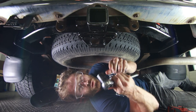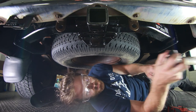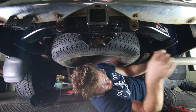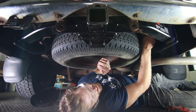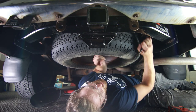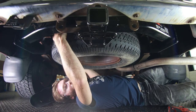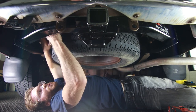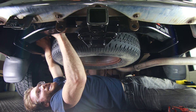I was trying to use a short half-inch socket on this back bolt but it's not deep enough to fit over the bolt, and the deep socket I have is too deep. So I'm just going to use a regular wrench and snug that down. This is where dropping the spare tire would actually be helpful. It wouldn't be a bad idea to put some Loctite on these bolts, and if you're not doing that you'll probably want to check them after a month or so of driving, because bolts can loosen up during that first month of use and you might need to re-snug them.